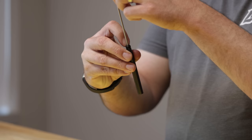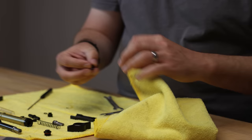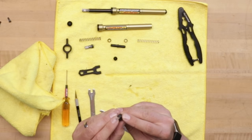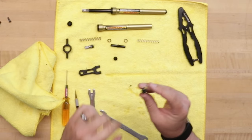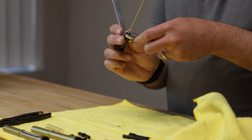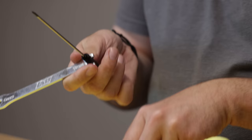We'll slide our spacer in. I'll go ahead and clean it since it's outside of the shock and could get a little dirty — clean inside and outside like we did before — then reinstall it first. Then we take our O-ring seal and slide that over the threads on the outside; it'll sit below the threads above the bushing. Then we take our cap last and slide that over, thread it on, and use the fork wrenches again — the nine millimeter end on the fork tube and the six on the cap. Tighten this one snug, but it doesn't need to be extremely tight because you do have that seal in there to help.